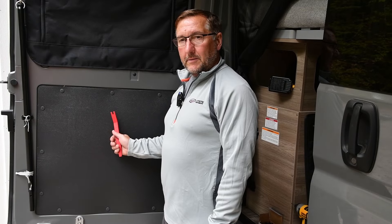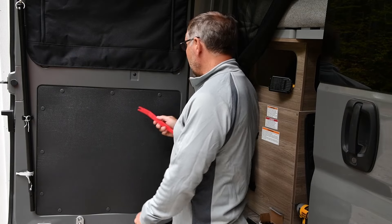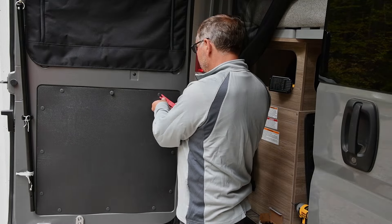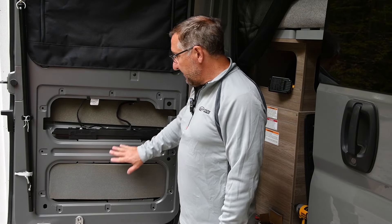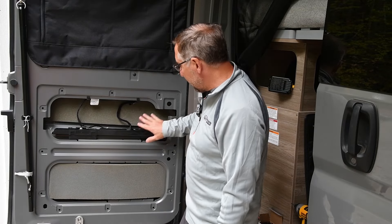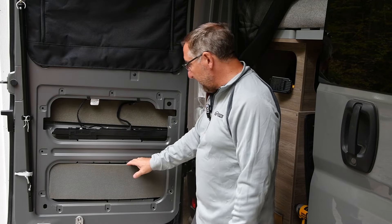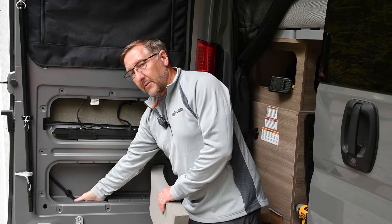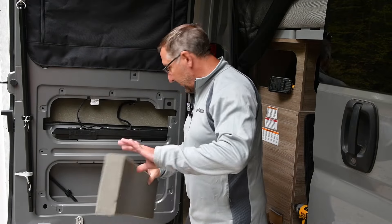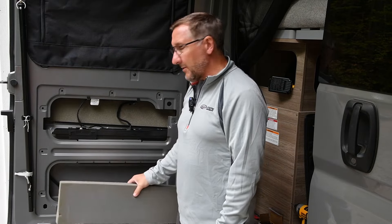This is like an interior molding tool for a car — hopefully it will work. We have that panel off. Maybe this is what people are talking about with the insulation. There's a very thin piece here, with a lot of air space all over. You don't want to interfere with the spring mechanism, but down here there's a piece that doesn't go all the way down or across. So I'm going to see if we have some closed cell foam we can put in here to supplement this little piece — it really doesn't seem like it's enough.